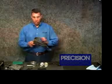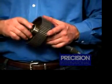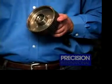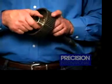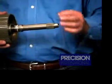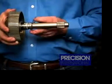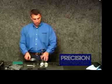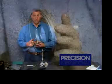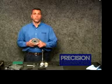When servicing this vehicle, pay close attention to the inner surface area where the seal rides — this surface should be polished very nicely with a scotch-brite type product and 600 extra fine sandpaper. Many technicians have related this directly to the butt-cut plastic rings on the input shaft. These plastic rings are found on late-model 518s and they seal very nicely — that's not the issue. Once you look at how loosely the factory inner seal fits in the piston versus how the Precision seal fits, you'll see the area of leakage concern and know how to fix it. Look for the Precision fix for this in the KISS kit.